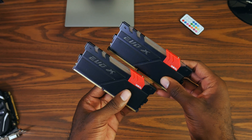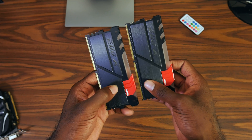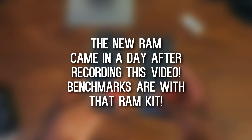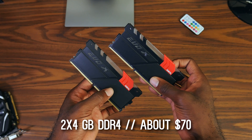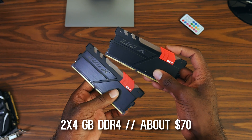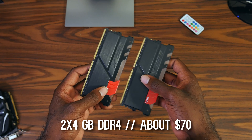As for the RAM, I have a 2x4 GB kit of DDR4 memory. This isn't the exact model I ordered, as the one I ordered is still in transit, but RAM will perform identically if used at the same timings and frequency. I would recommend getting at least 8 GB of memory and the highest clock speed you can afford, as APUs really do love fast memory. Also make sure you get memory in dual channel — do not get a single stick. The performance difference is vast, and I'll link a video showing that in the description.